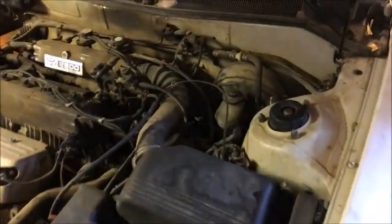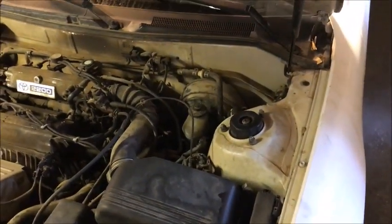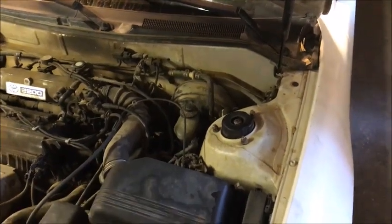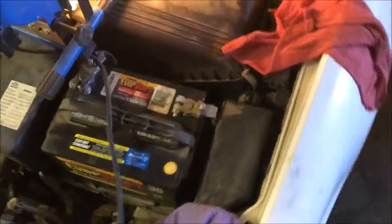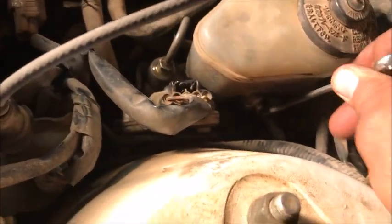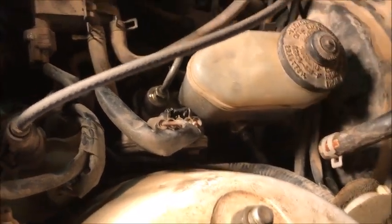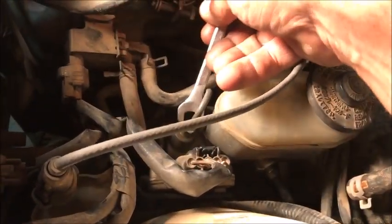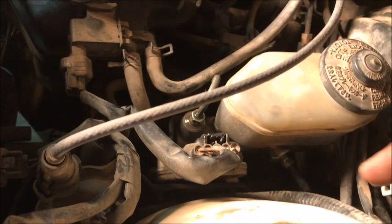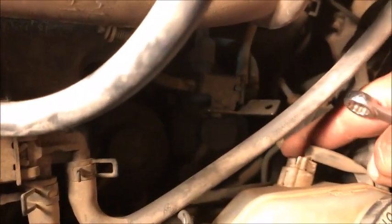First, I'm going to pull off the two brake lines, then disconnect the tabs going into the brake booster from the master cylinder — there should be two nuts there. You really want to use a line wrench when cracking loose those lines; it's a 10 millimeter. I got lucky that they loosened up for me, but use a line wrench to avoid stripping them. I have a rag underneath to catch drips.